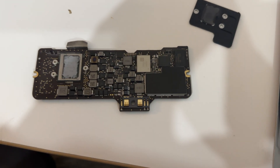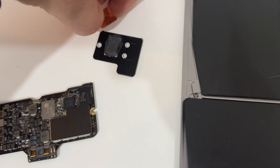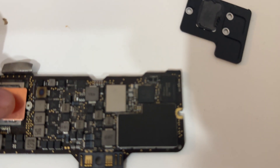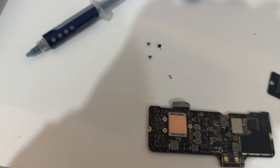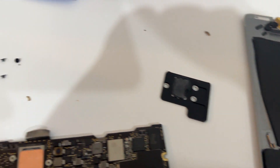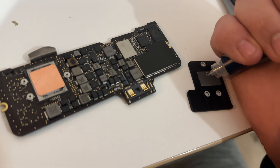I'm placing this copper piece on top now — you only need one because it covers both the CPU and the area perfectly, it's just a perfect fit. I'll apply thermal paste and get this screwed back on, but I still need to clean the thermal paste off the heatsink first — so just bear with me.